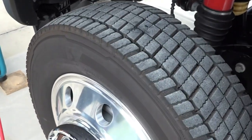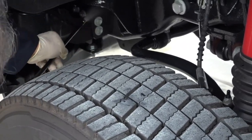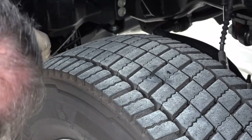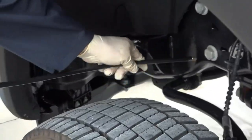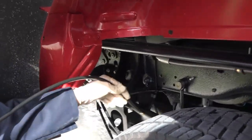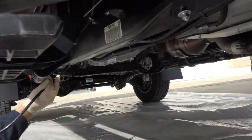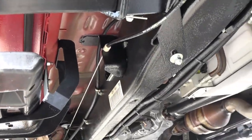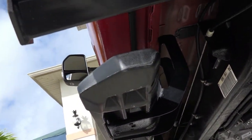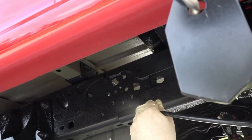This is how I sprayed the whole underbody. I sprayed the whole underside of the truck and inside the frame rails, sort of off camera, because when I was on the creeper on my back under the truck it was almost impossible to spray using two hands and hold the camera. So after I got it all done, I had my wife hold the camera and film so you could at least see some of the application process, where I tried to spray as straight and uniform as possible. I did put on a relatively thick coat — it's never been sprayed before and it went on beautifully.